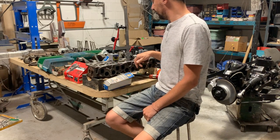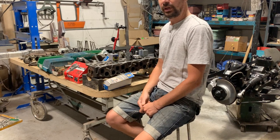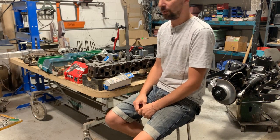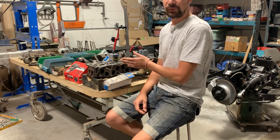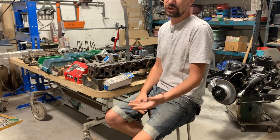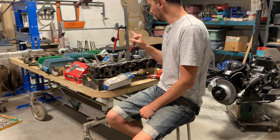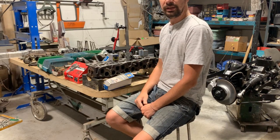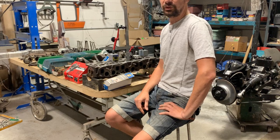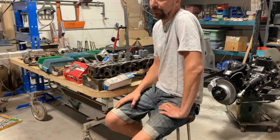During this month it occurred to me that I never measured the valve-to-valve-guide clearance on this project. So I set up a little jig and I'm going to go ahead and measure all of the valves to see if we need to change the guides. Obviously if we change the guides we're going to have to re-lap everything with the new guides and new valves as well.